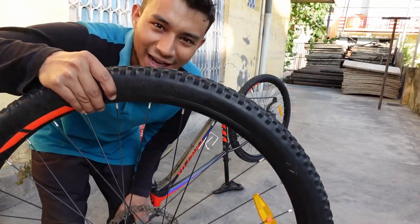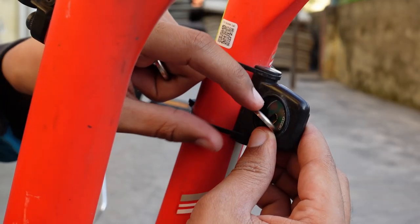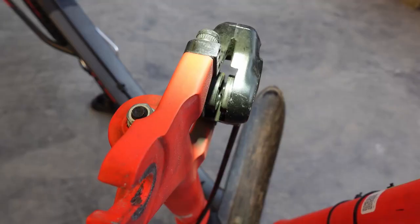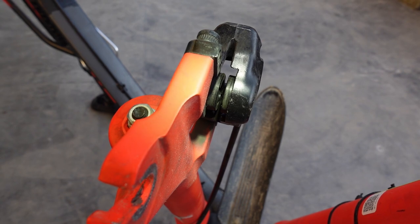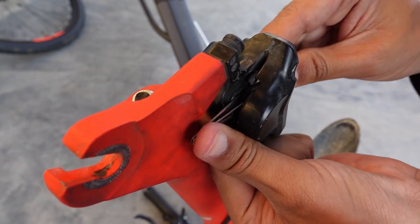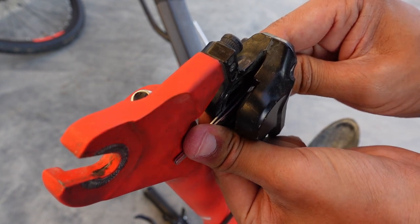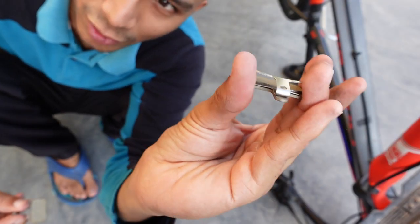The wheel is removed. Now I will change the battery cell. Now, about the brakes — I have removed my front disc brake caliper and I'll show you here. The disc brake pistons need to be pushed back using some object, like a tire lever or a chisel, to make space for the new disc brake pad. I used a flat tool for this.